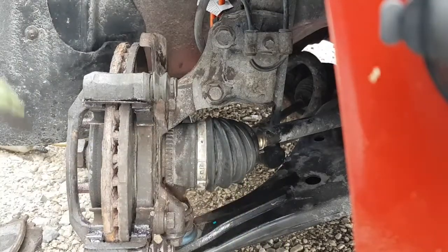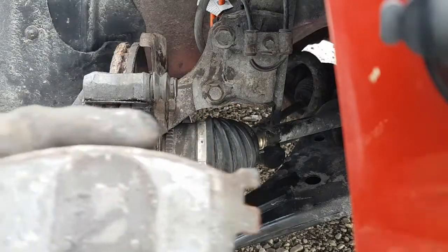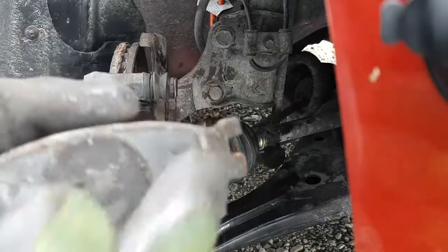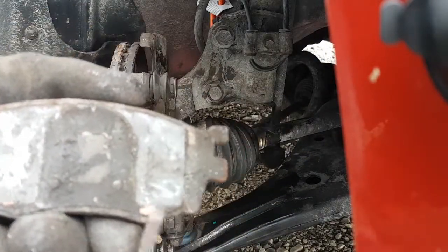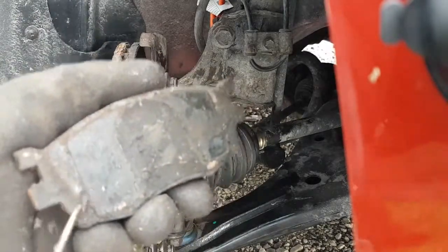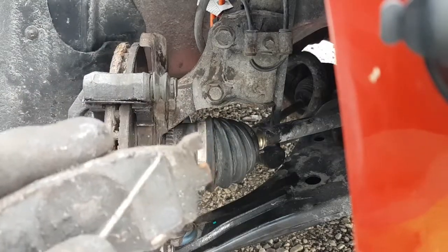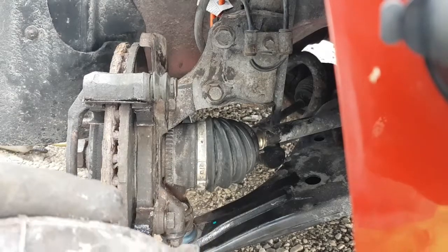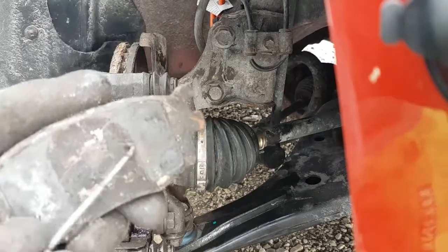Alright. Now, normally, I would put this grease, the Silglide, or the brake lube, whatever you want to call it, on the back of the pads and also in behind the shim. Some pads have shims that come off. I don't think these ones do. No, these are just cheap aftermarket, so I can't get it off. But depending on the kind of car you have, I think the OEM pads for this car have a steel shim on top of the pad here.